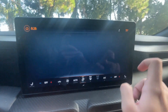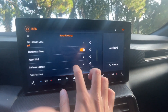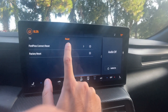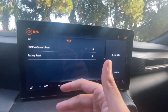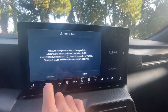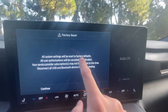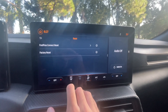So we're going to go ahead and go to settings, then go into general, and you're going to want to scroll down until you find the reset option. You can do a FordPass Connect reset — that's basically if you have the FordPass app on your phone, it can delete all of that stored data so you can re-sync your FordPass app. But for this video, we're going to be doing the factory reset. Click there and you'll get a message confirming it's going to restore to factory defaults. Go ahead and click continue, and you can see it's resetting to factory defaults.